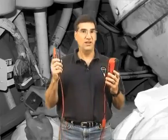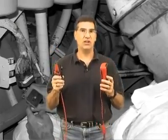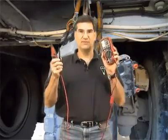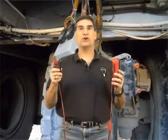Three faults: open, short to ground, high resistance. This is kind of slick. If you read system voltage loaded, then that means you don't have a harness problem. Let me repeat that because it bears repeating — if you read voltage with these leads and you see system voltage when you do, and you push this button and nothing happens, you just proved that there's no fault in the wiring harness.